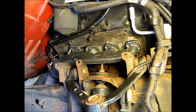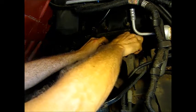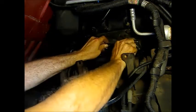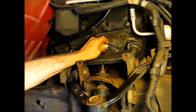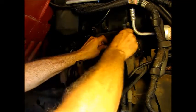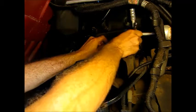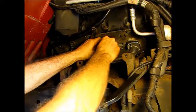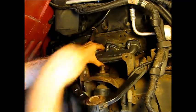Before we go any further, let's move on down to the last two ports. This also happens to be a Ford OEM part — I went all OEM on this job. This is just concerning enough to make me worry about some of the aftermarket stuff out there. I have a friend who did this job and wound up replacing the manifold several times because his China-made aftermarket replacement part cracked on him. So spend the extra money, get the original part. Looking at the molding marks, it looks like it's made in exactly the same mold as the original installed in this 2000 — which was comforting, no question about it.